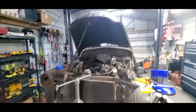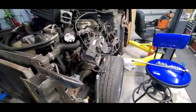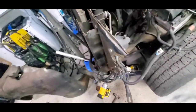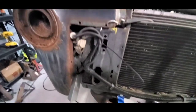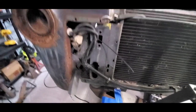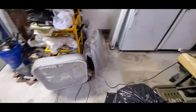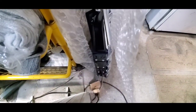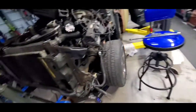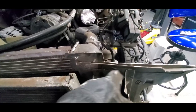What I've done is I've taken the fender off. Essentially what I'm gonna have to do is that grill has to be countersunk in there - it doesn't sit flush on the top front of the fender like I thought it did. It's actually very thick and it sits back in there, so it's really gonna have to go back probably this full distance right here.